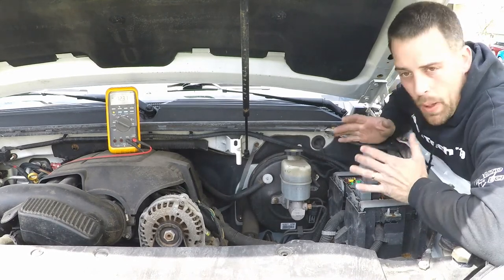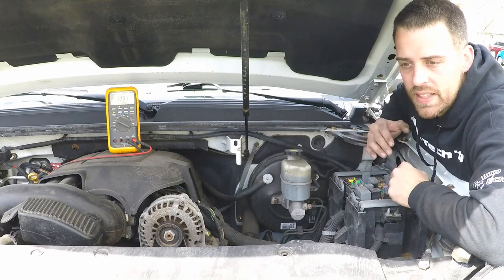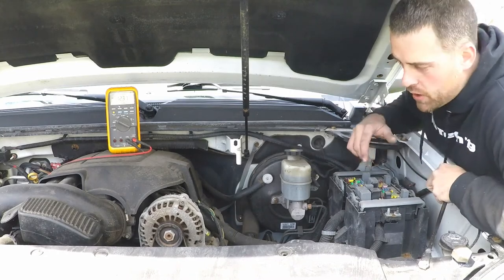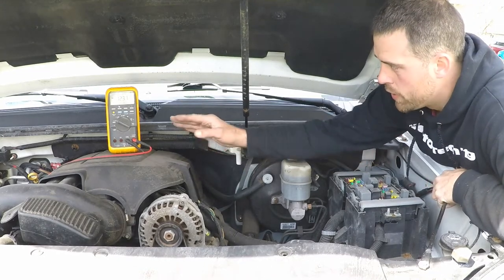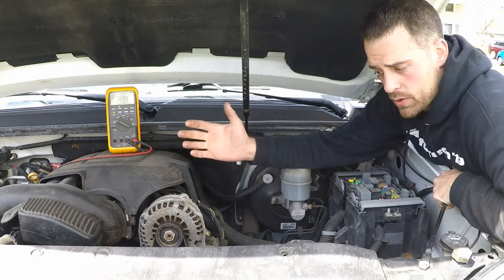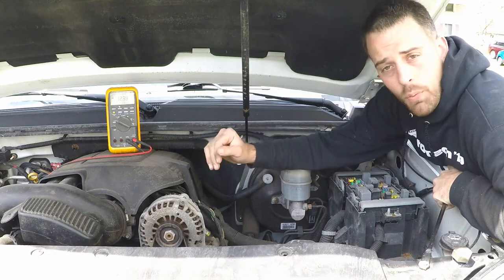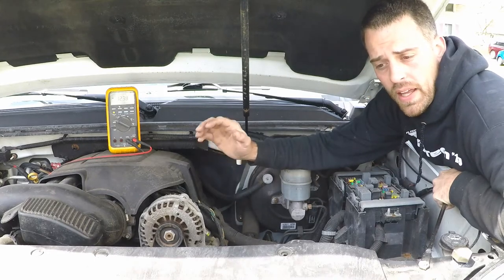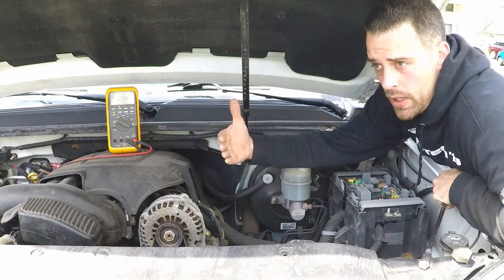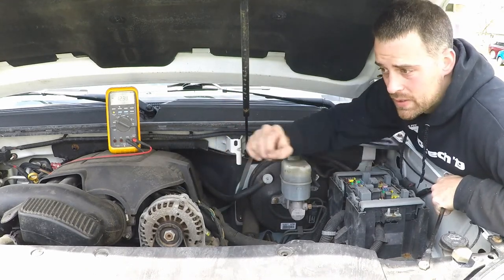When we start it up, it's probably going to sit there for at least a couple seconds, maybe 5 seconds tops, up to 10, and it's not going to charge. What it's going to do is you'll see the voltage drop on the screen because you're consuming power with the starter. But then it'll take a minute. It'll kind of recover back close to what we have here now. And then ultimately it'll kick on and jump up to its maximum voltage. That's actually on purpose.